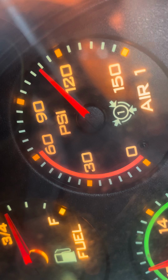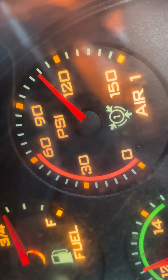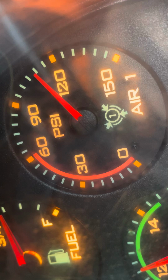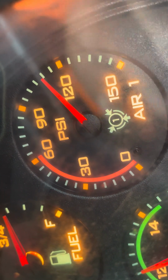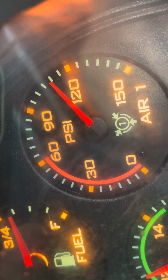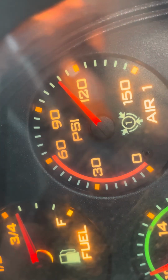Do I have permission to continue? Because it was more than 15 psi, you have to have permission. So at this moment, the trooper says, okay, yeah, go ahead, or he can fail the truck and the test would be terminated. So let's say he says go ahead, 16 psi. Okay, starting my 3 psi air loss test from 109 psi now. Let's say the minute is up, I'm still at 109 psi, that's 0 air loss.